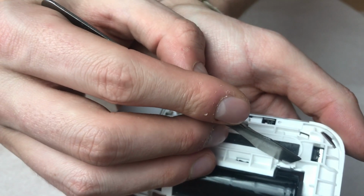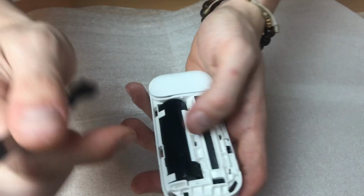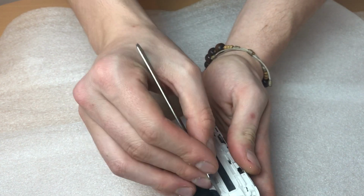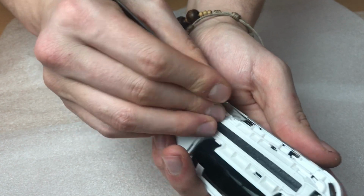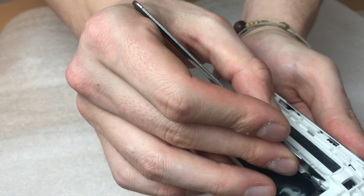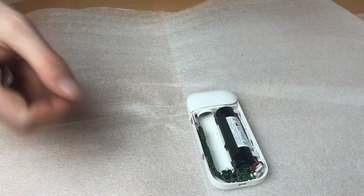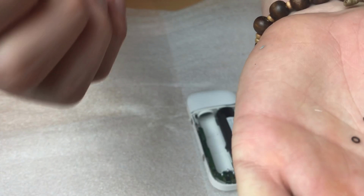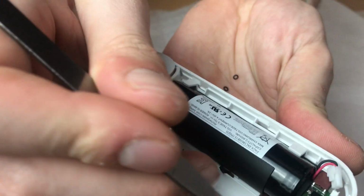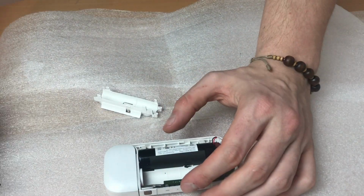There are some plastic clips here and here that keep the pen holder in the housing, the plastic where the pen goes. After you pull those clips, push it down and start from this side. Be careful, there are 2 plastic or rubber bands that go inside on these pins in order to protect the motherboard from the plastic of this housing. You don't want to lose them.